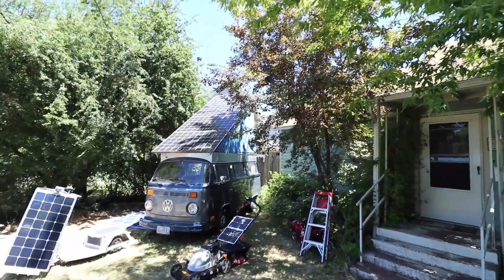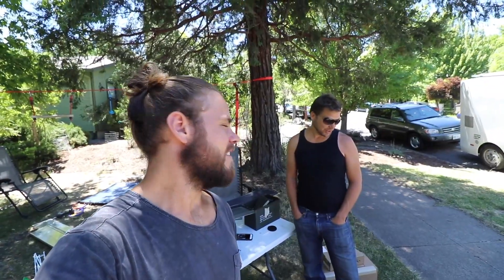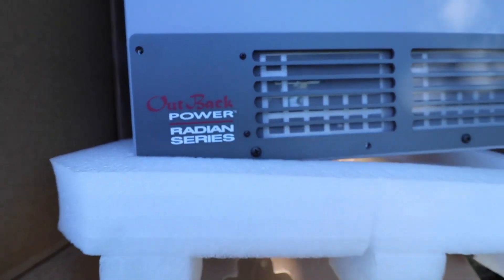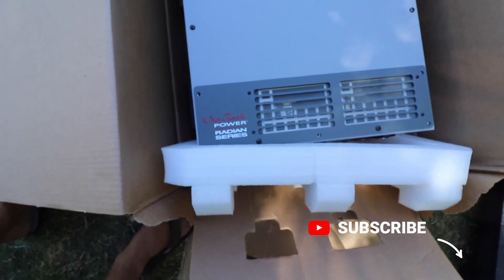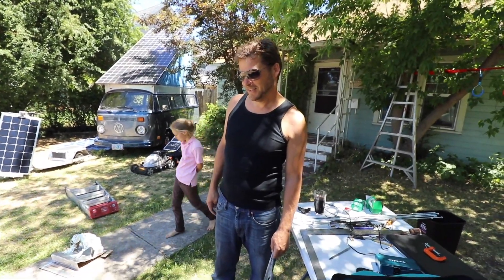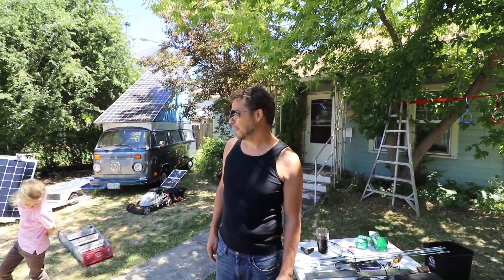It's going to pump electricity from our secondary battery pack right through the vehicle for our accessories, and also charge our secondary battery pack through it. If someone turns up in their electric vehicle — say Brett turns up in his VW bus and he's not drawing enough power with that solar panel on top — Brett could roll up next to me, plug his van in, and get a charge because I have this big brain in my vehicle. This inverter will also allow us to contribute power to the grid. It has grid-zero technology, so when we're at full charge, if it's legal and safe, we can actually supply power to the grid. The Outback Power Radian series, tested in outback Australia — going to stand the test of time, hopefully. We could have gone with a cheaper option, but that might not work — it would break in a month and we need this to last years, maybe a lifetime. I've used Outback parts through my off-grid history and they're 100% reliable.